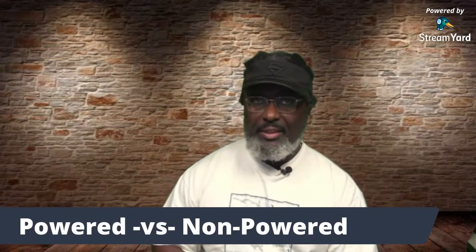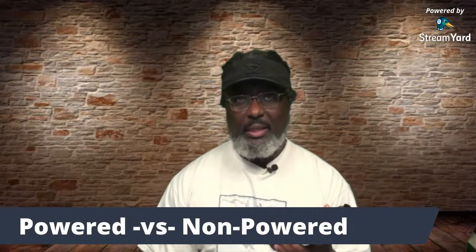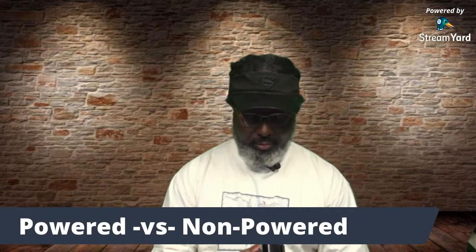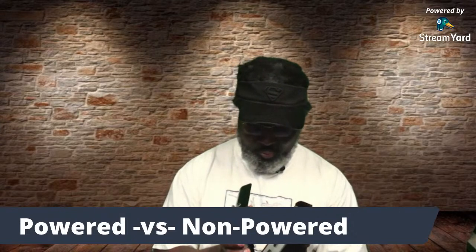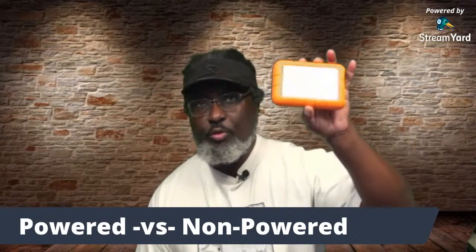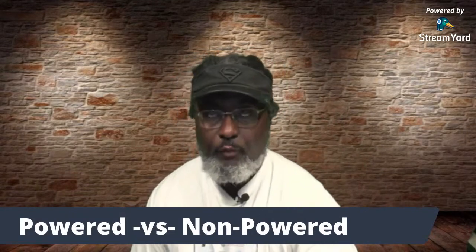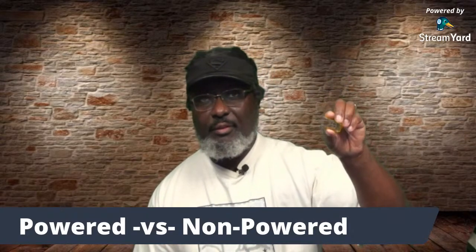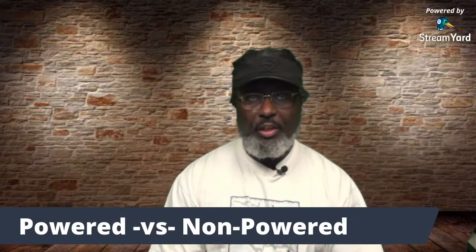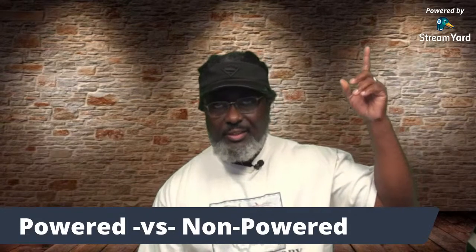So that's one thing I would say, do not use powered drives, because you don't want to be at an event and the power supply, the AC wall wart, or whatever, fails. It stops working. So that's why I said don't use these. Out of all the drives, use your externals that don't require power. Hell, if you have one big enough, use a USB flash drive. I've done a video where I used a USB flash drive for the main hard drive. Check it out. It'll probably be floating right here when I get a chance to post it.